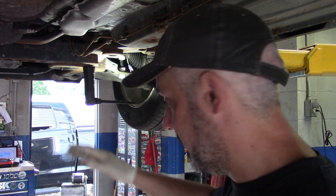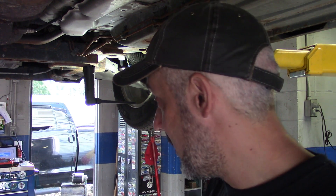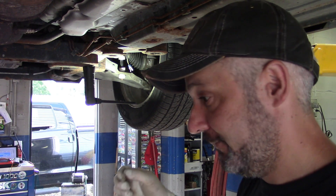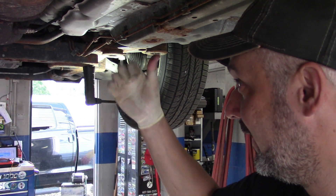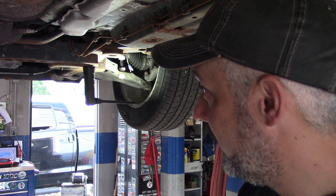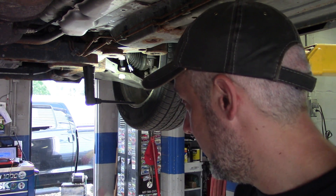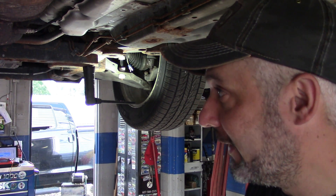I know this is a little out of reach for some folks, but a lot of you guys in the shops — I see on Facebook in some of the groups — there are a ton of people that have the MaxiSys Ultra. Hopefully you're taking advantage of the built-in signal generator and using it in your diags. You can use it to substitute signals on anything. For example, a crank signal — if you've got crank signal down at the connector but it's not making it to your ECM, instead of cranking the car over to chase that signal, you could use this little signal generator. There are so many uses. Anyway, why don't you talk to me down in that comment box — questions, comments, criticisms, concerns. If I can do it, you can do it. Thanks for watching.